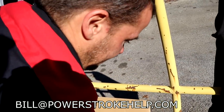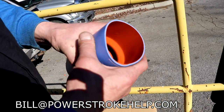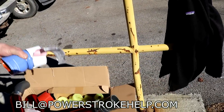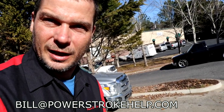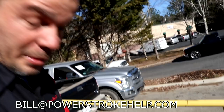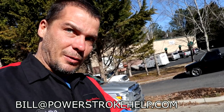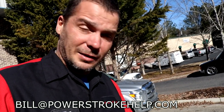Right. This is the intercooler side, and it has what it needs to hold on to this. But the big deal is there's a lip grip on the intercooler itself that grabs that. Correct. But these tubes are blowing off because people are not installing them correctly, and they're not putting Ford parts on these trucks. And in the end, I'm the last guy that touched it. It's all my fault that you went and bought this Taiwan kit. Right. And so what I want to emphasize here is there's nothing wrong with your Ford tubes. You need to stick with the cold air system that's on it, and you need to buy the Ford boots.